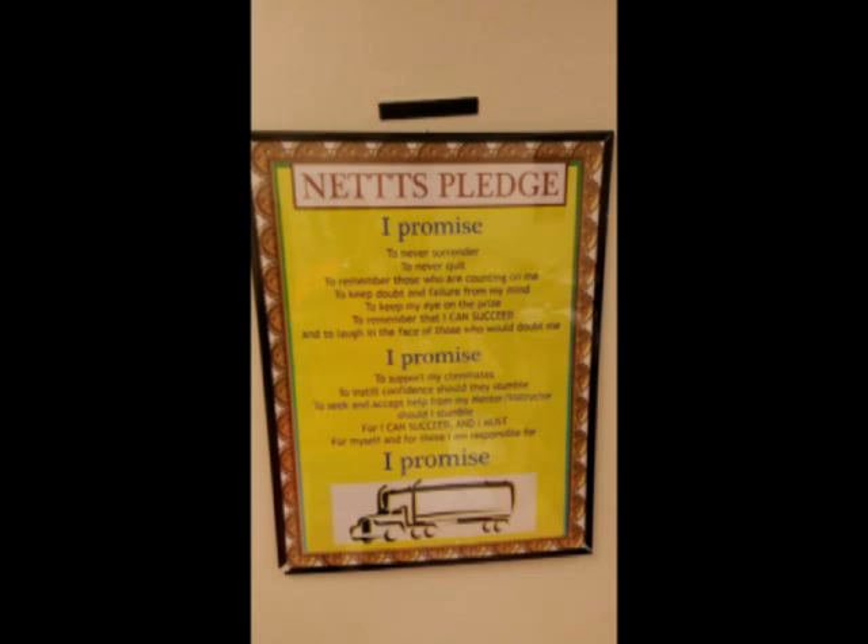Check that the vehicle is not leaning to one side. Number three: as you walk down the left side, place your chock blocks down at the trailer axle — one to the front of the tire, one to the rear. Number four: check for solid ground under the landing gear by stomping on the ground under the landing gear on both sides.